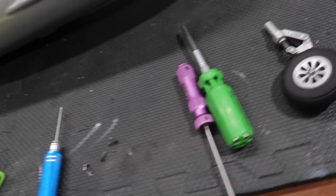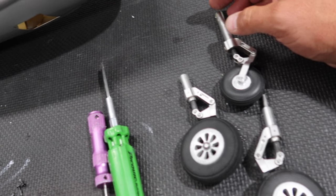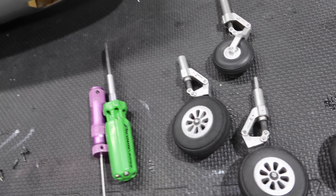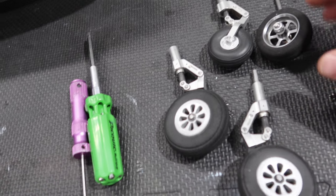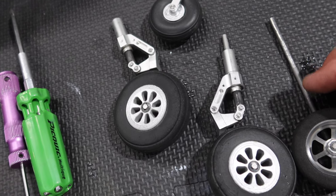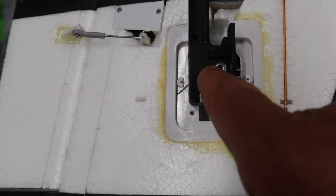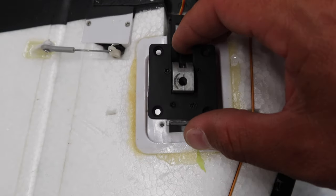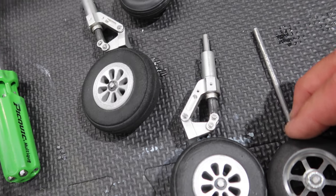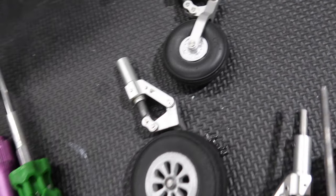I think this is going to work out just perfect. I yanked all of the gear out of the Havoc. The nose wheel actually just looks perfect the way it is — the full-scale airplane has quite a bit smaller nose wheel than the mains. We are switching out the mains as I mentioned. So this pin comes out of the eFlight Retrax — I pulled one of the pins out so far. On these eFlight Retrax it's the pin that goes through the center of the trunnion pivot point. We undo that with a 1.5mm Allen key, the pin comes out, and we are bang on the exact same length.